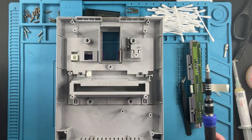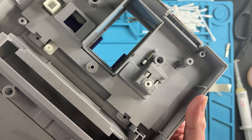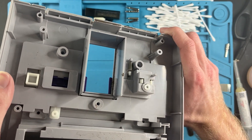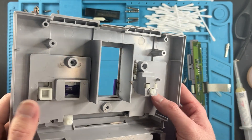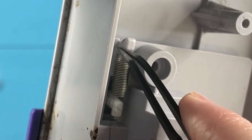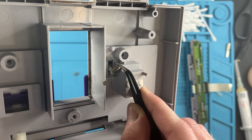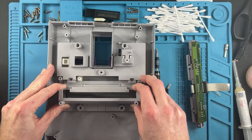We should take care of the lid as well - I'm going to remove seven screws. Now that those are all removed, we can look at this spring here - this is the reset button. It's a little stuck, but that spring makes it so it keeps retracting so it can be pressed again and again. In this case the dirt is causing it to not retract, so I'm going to take small pliers, take the little hook, and wrap it around - oops, that pops off like that. Save this as well.